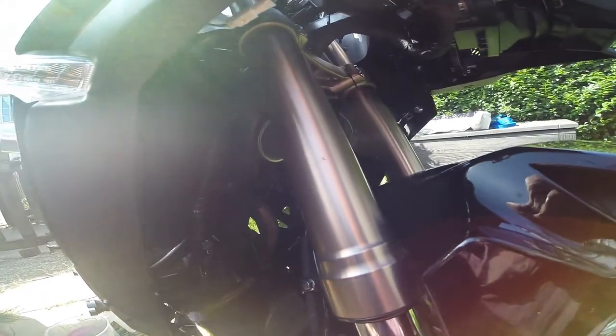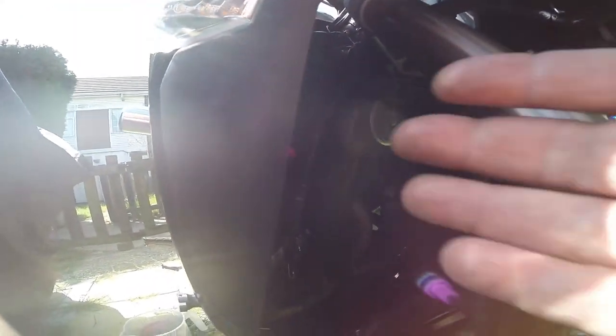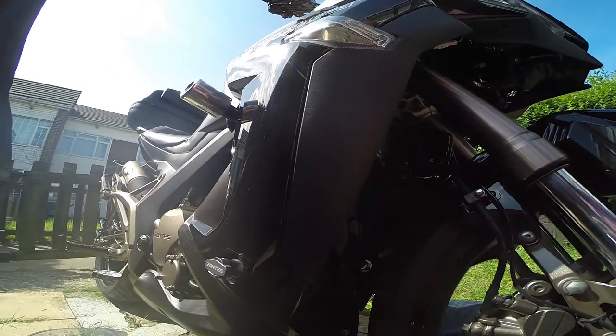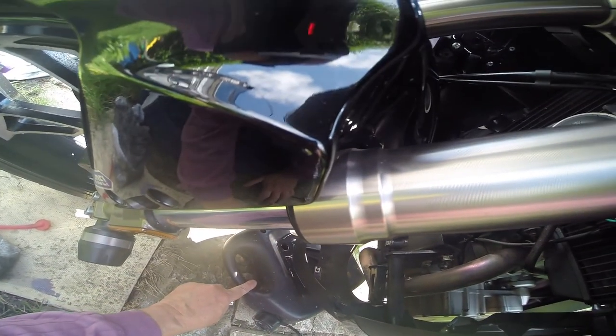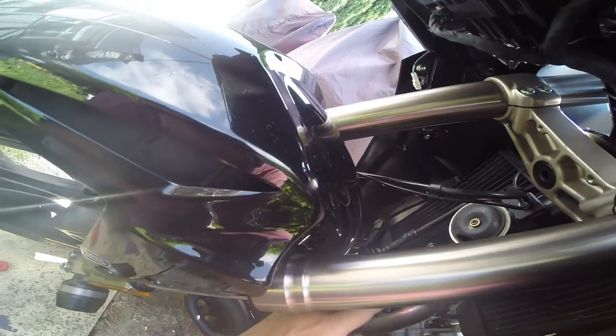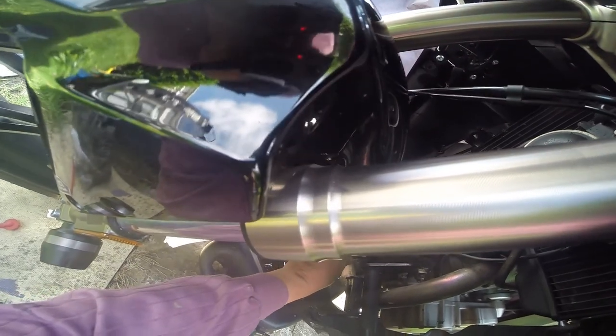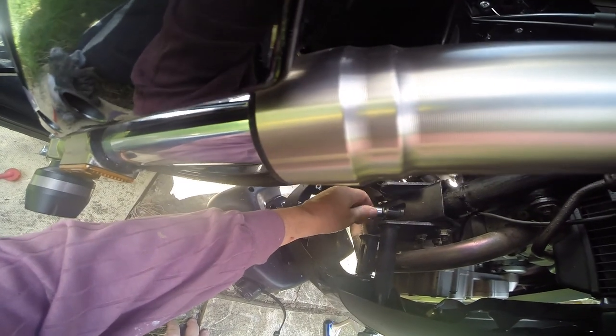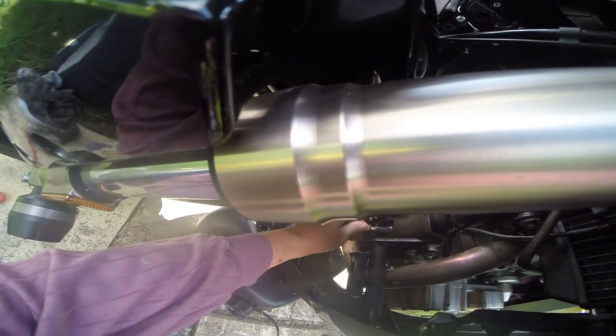The two radiators are spotless — they're fine. Just check your indicators to make sure they're nice and tight, there's one on each side. That oil will have drained out now, so I'm going to put the bolt back in and then undo the nut at the front here. I'll put the container underneath. If oil comes through there that's fine — if not, I know next time I'm not going to take all this off, I can just take the small shroud bit off. I'm going to take this off now and see what comes out of the frame, just to show you what comes out of the upper frame.